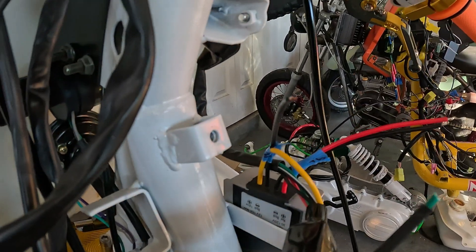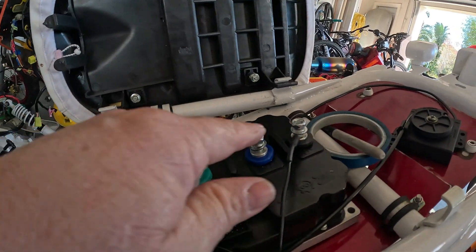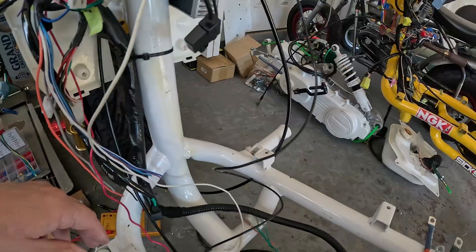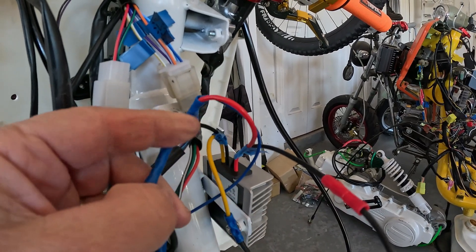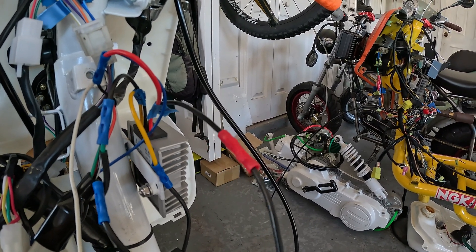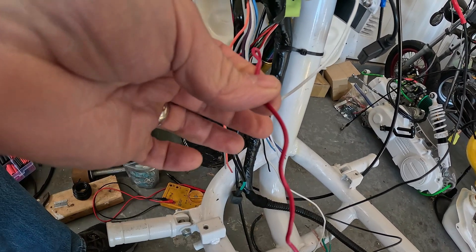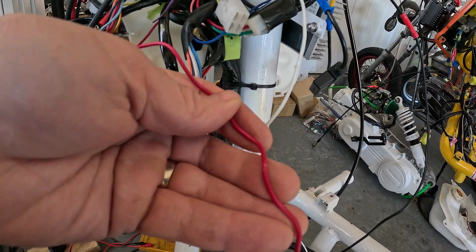We don't want the frame as the ground — this will all be isolated. Just run this ground to the negative on the DC-DC converter. That smaller green wire going to your battery — we don't need that anymore. We're going to connect it to the converter negative. The controller and battery will have big fat wires going to positive and negative to power the motor. I've also got a negative wire coming from battery negative and a positive wire from battery positive for the rest of the bike. These wires come down here — the negative wire goes into the DC converter. This just keeps it straight in your head: the negative for your 96V, 72V, or whatever system, and the positive coming down at that same voltage — not a lot of amps, so it can be a small wire.